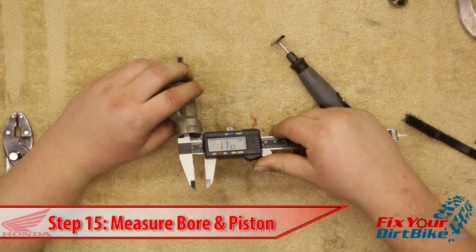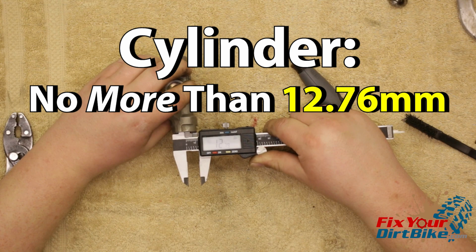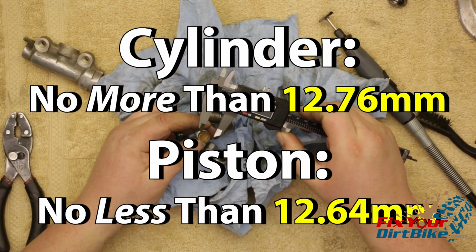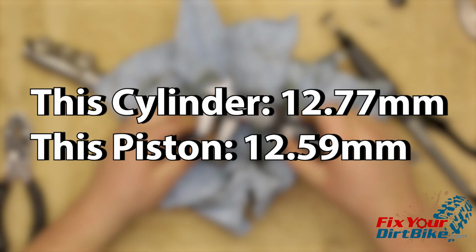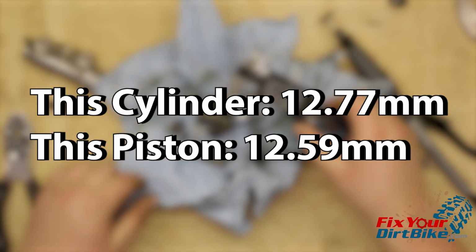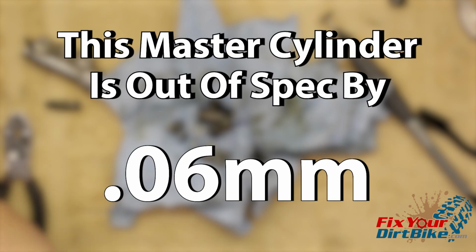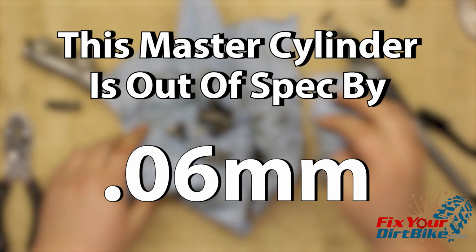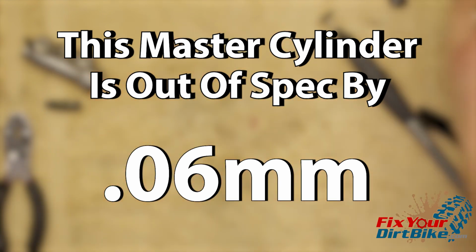Measure the inside diameter of the cylinder bore and the outside diameter of the piston. The cylinder bore should measure no greater than 12.76 millimeters, and the piston should measure no less than 12.64 millimeters. This cylinder bore is 12.77 millimeters, and the piston is 12.59 millimeters, which means this is out of spec by 0.06 millimeters. I'm going to take my chances and keep using these parts. If you want to reuse parts that are out of spec, I didn't tell you to do it.